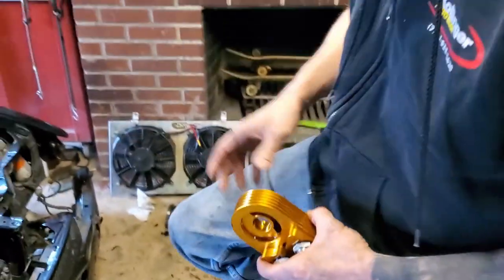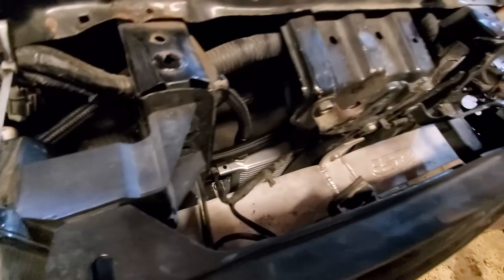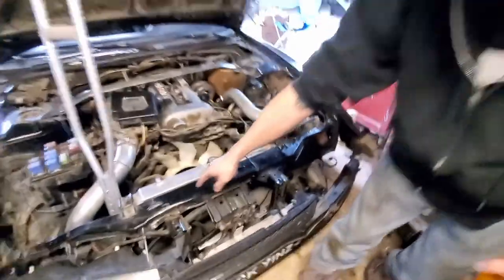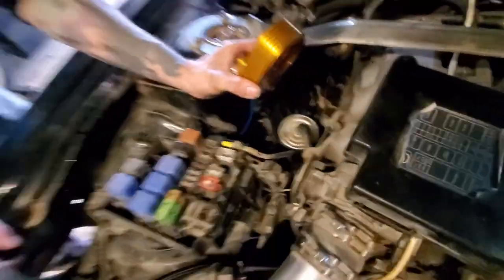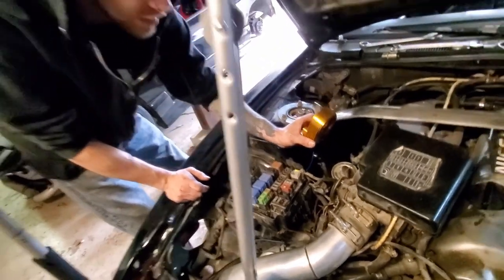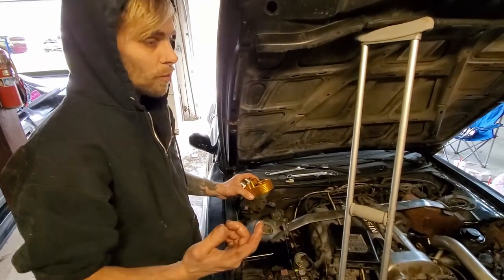So we have the oil cooler right here in between the intercooler and the rad. So the air passes through the intercooler into the oil cooler. I have the lines ran up behind the headlight and literally down to the side of the block. We're gonna smack this oil sandwich plate on the adapter, which comes with the kit, S13 and S14. So we're gonna put the S14 one in it. I got a K&N 1008 because it's a short version of the 1010.